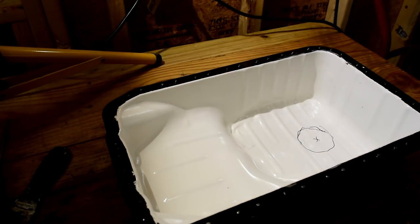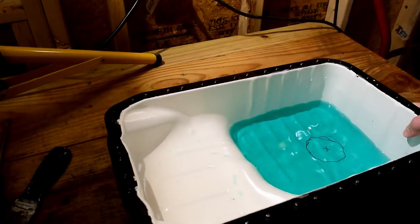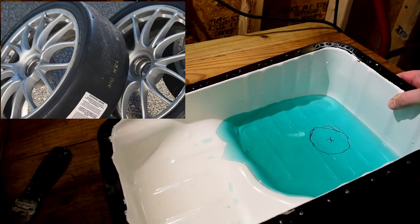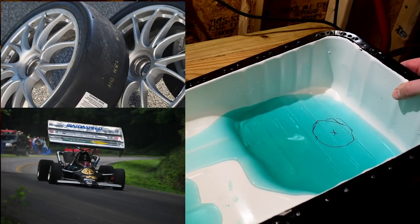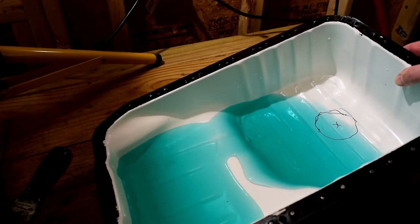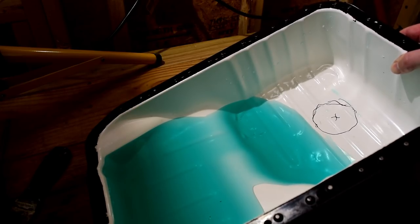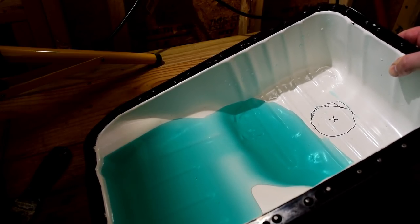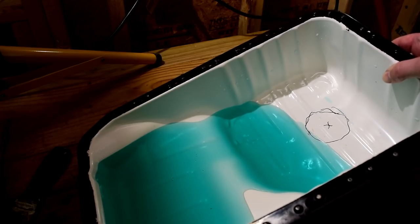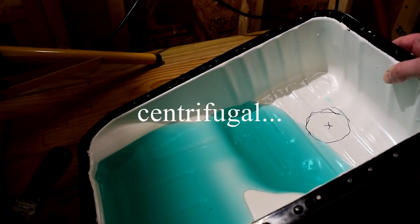We're going to add some quote-unquote oil here to show you what can happen. Under very high cornering loads — typically associated with race compound tires and/or functional aero — on right-hand sweepers, the oil can actually slosh far enough towards the shallow end of the oil pan to leave the oil pickup dry. Once you get to this point, this leads to no oil going through the pump, no oil pressure on the engine, and we all know where that goes. If you want to see the force vector diagram of why tilting the oil pan on a flat table simulates the centripetal force of a turn, go over to Engineering Explained — but trust me, it does.